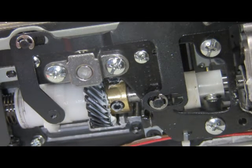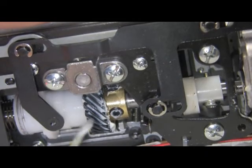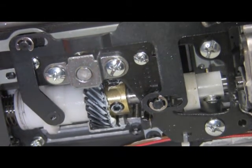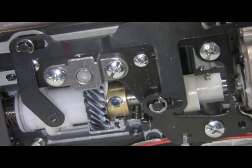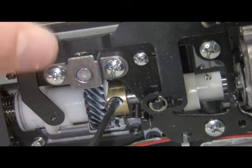Turn the hand wheel, turn the machine over, and hold the hook race to make sure it did not move. When you hold it, tighten the screws — turn the hand wheel and tighten the other screw.